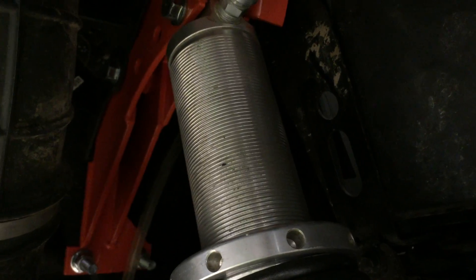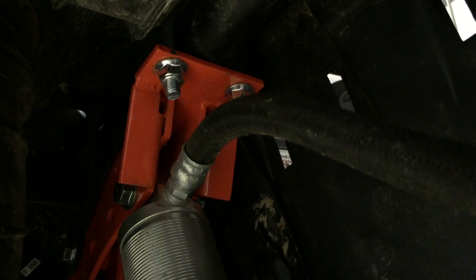Pretty simple to do. The back bracket — when you take that shock bolt out, there's one bolt right up there that goes where the factory shock bolt goes. This side went in good; the other side is at a slight angle so you can't get the bolt through. The directions say to drill it out. You've got a U-bolt up there on the frame and a U-bolt down there, and just that one bolt in the factory bracket — it puts the shock more straight up.